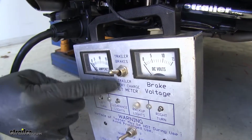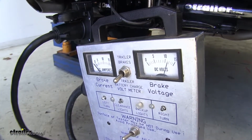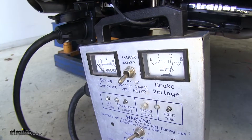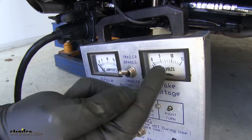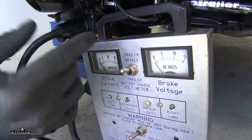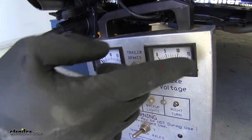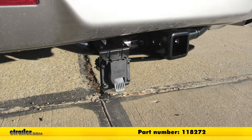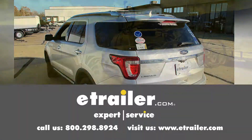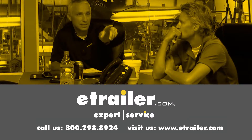Now to test our power wire, we'll just want to switch over to our charge meter. As you can see, that's giving us a nice strong 12 volts there, and this is only going to work when your key is on, so that's something you do want to keep in mind. If you do have a brake controller installed on your vehicle, now would be the time to manually operate that and make sure that either you can hear your brakes click or engage on your trailer, or if you're using a meter, that you're getting amperage and voltage. Now with all of our functions working properly, that completes our installation of the T1 Vehicle Wiring Harness for the factory tow package, part number 118272, on our 2016 Ford Explorer. Thanks for watching - click the link in our description below to shop, learn more, or visit us at eTrailer.com, and leave us a comment if you have any questions.